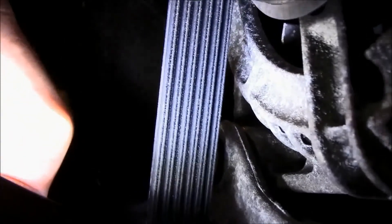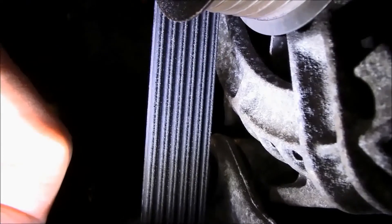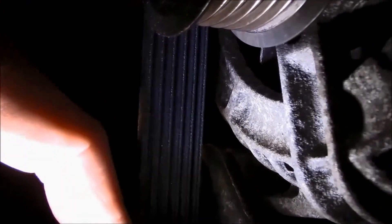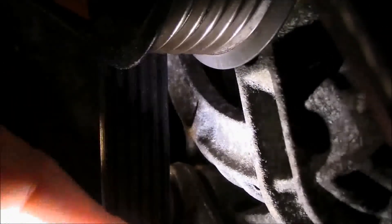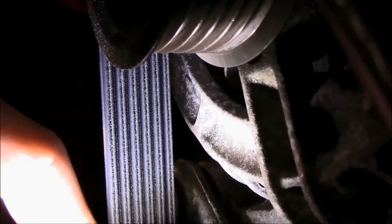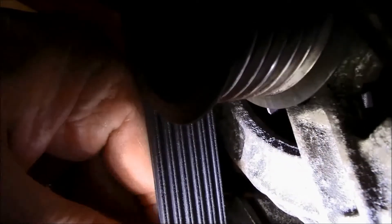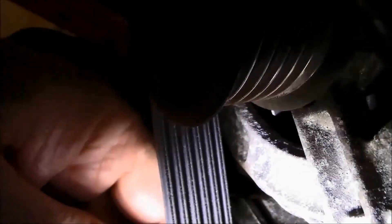This belt is obviously on the car because I'm running it, but it's not just a V-shape like the other belt — it's called a W. It's got a V-shape to it, but if you look real close to the top of each V, there's a slit in it to make almost a W. Additionally, this belt has a covering — kind of like really, really fine felt almost on it. I'm going to spread that apart so you can see it. That slit in the middle of each V, and the type of cover they put on this and how they treat it, is what makes them so quiet. You can see the difference in those two belts and just the way they're constructed.